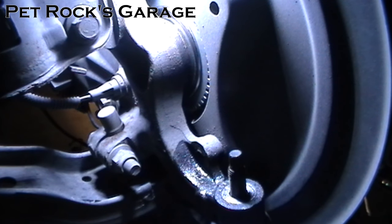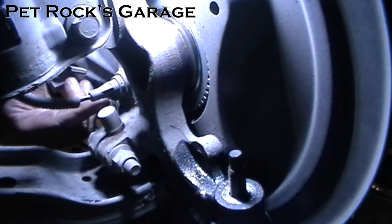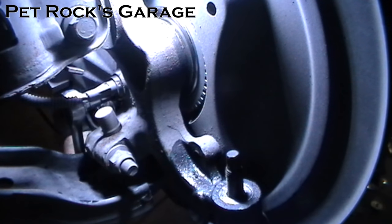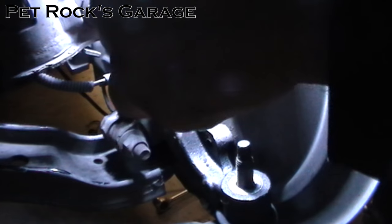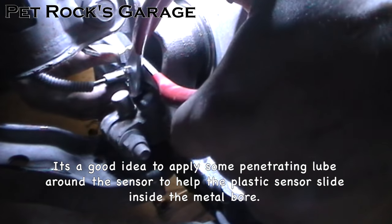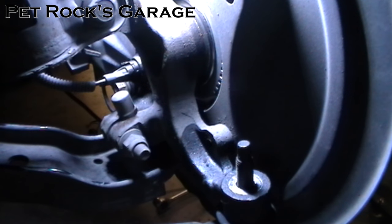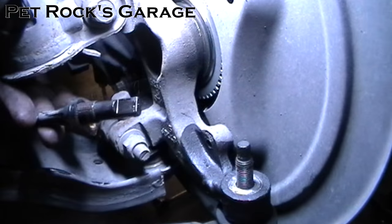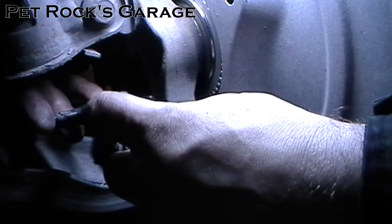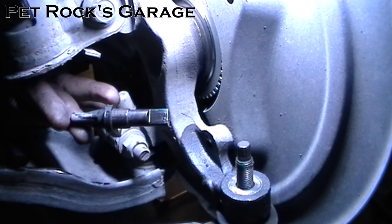However, vehicles equipped with ABS sensors or speed sensors on the front end are very sensitive, like this one right here. So it's a good idea to remove the sensor before you start banging on the end of the spindle so that you don't damage this relatively expensive sensor. Put some penetrating oil on the bolt and zip it off. Take a pair of pliers, put it around the housing, and rotate back and forth to break up any rust holding the sensor in place so you can remove it without breaking it. Just wiggle it out of the way.